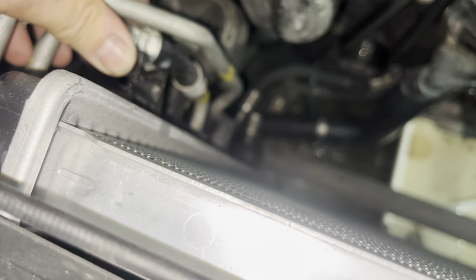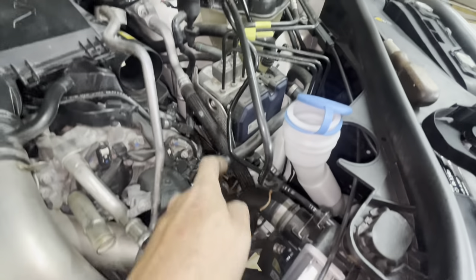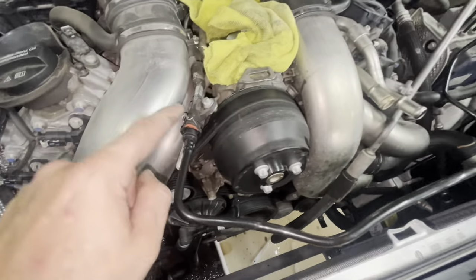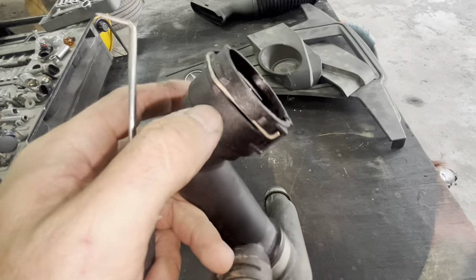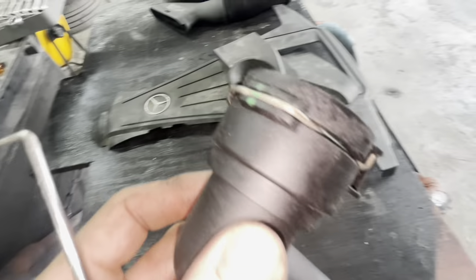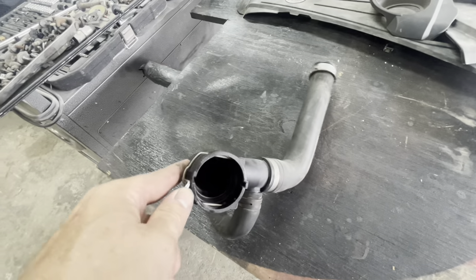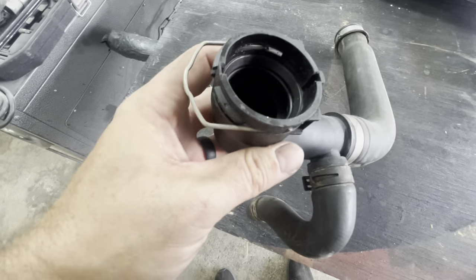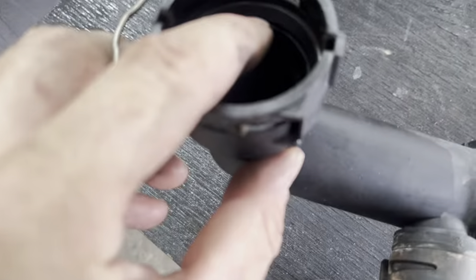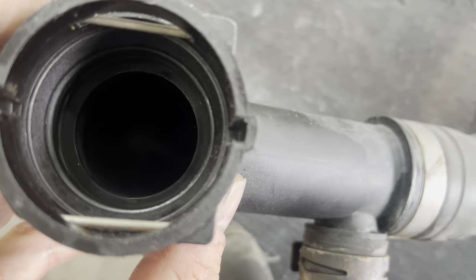To remove the fan, push it open like that and then pull up. To get it out, I did have this plastic overflow line unhooked and out of the way. These are the little horseshoe clamps — you'll have some on your radiator hose. To get your lower radiator hose apart, simply put a flathead or a pick in there and pull this clamp open. That comes open so the hose can slide out. When you slide it back in, these little tabs lock the hoses on. You're going to have quite a few of them — they all work the same way.